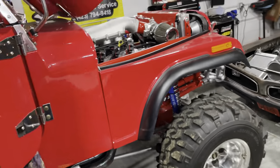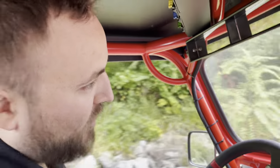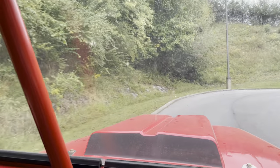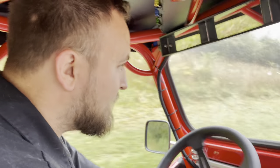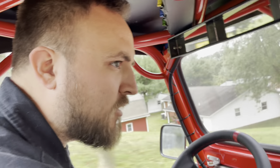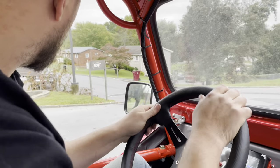The customer can now go get it dynoed and have some fun. We've got the Jeep running — it's been a while since it was driven and it needs a little tuning; there's a slight sputter. Temperature is looking good at around 140 degrees, oil pressure looks good, no leaks. As it warms up it's doing better — that's probably the Holley self-tuning as it starts up. We'll take it up the road. Brakes need a little work but not bad.